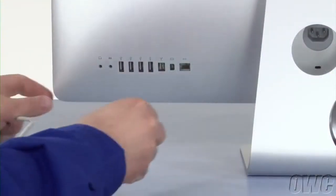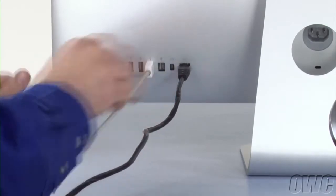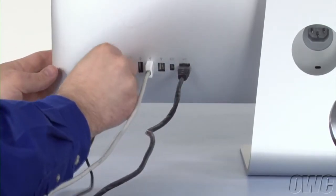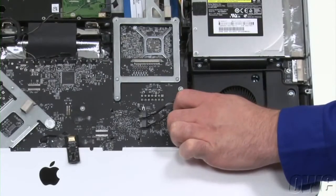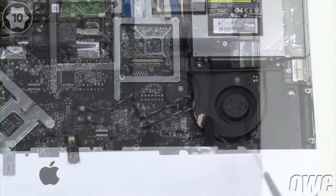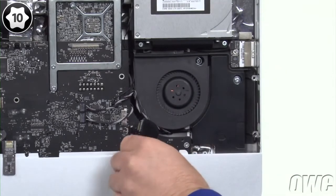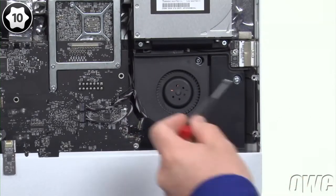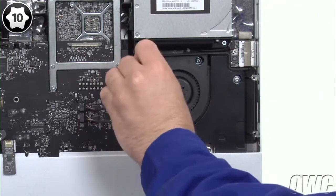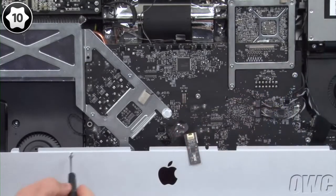To help align the logic board, plug in as many cables as you can into the rear ports of the iMac. You don't need to fill all the ports, but the more you have the better. To aid in replacing the logic board screws, you can detach the audio connector. Then place the two middle-sized screws in the lower right two holes in the logic board but don't tighten them completely. Do the same with one of the longer screws in the hole to the left of the fan, then repeat the process for the remaining three logic board screws.